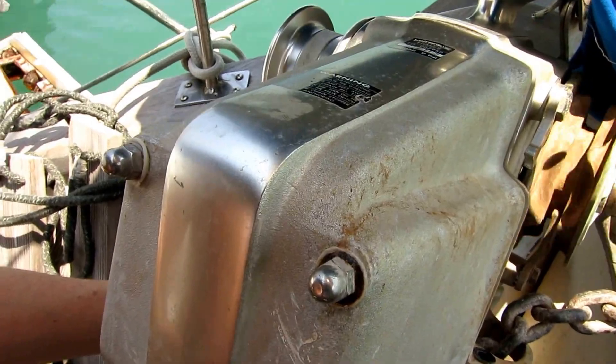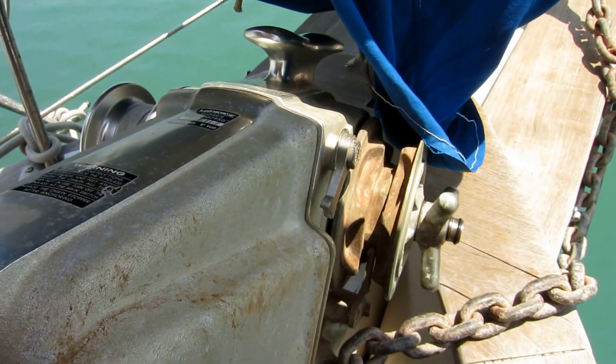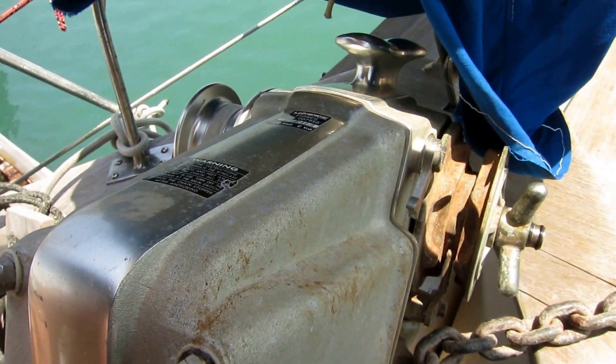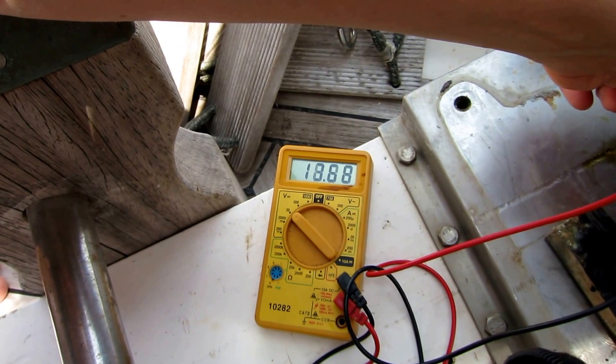Again, the other way. Voltage is good. Slowing right down to nothing — I can stop it with my hand. And then I've got the click: solenoid click with no motor running, but still getting voltage when I press the button.